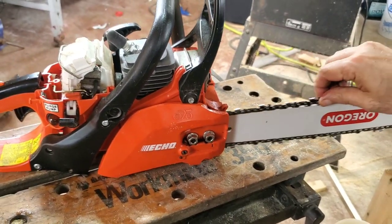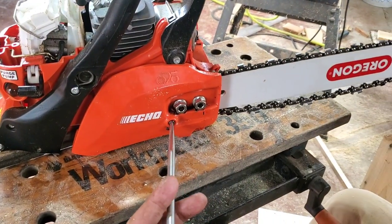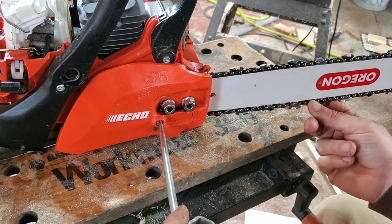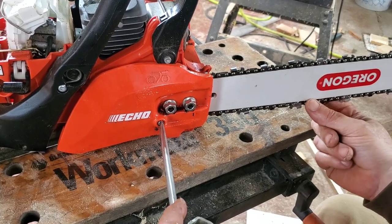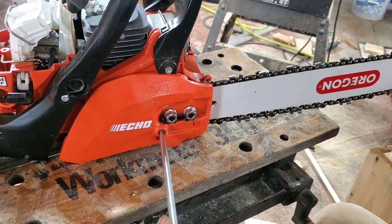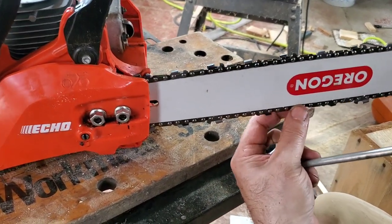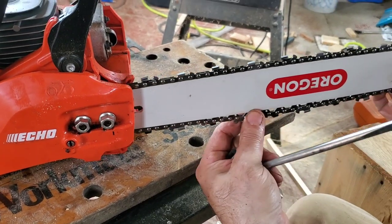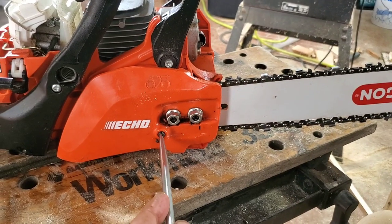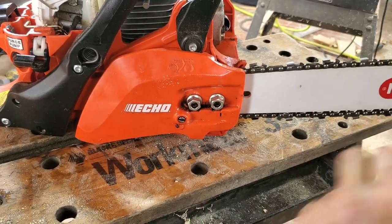And now this sounds a little funky because it's brand new and there's still the guide's full of paint. Okay, so look at the difference. So I'm adjusting it here. Right, and you can see that's got the snapback tightness you're looking for, but when you lift it up, look at that. So we pre-lift it up because it's going there anyway, guaranteed. And this is any saw, I don't care who makes the saw. And I like to roll it a little bit just to make sure, and I can still pull that down. But now the top's going tight.